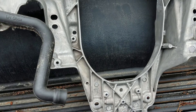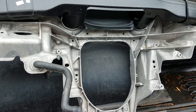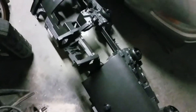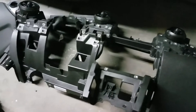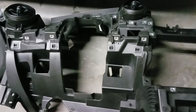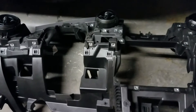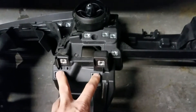There are some mounting points kind of in front of your center console, and I believe these holes here are the guiding pins that hold the air box in place — so this is the second step when you put it back in. Right here is the glove compartment and the four vents — this is the piece that goes on after the crash structure. Your steering wheel, airbag, and steering column are going to have to be removed because the steering column attaches to the crash structure support. This is what goes on second, and you can see all the different places where there are fasteners and snap clips.